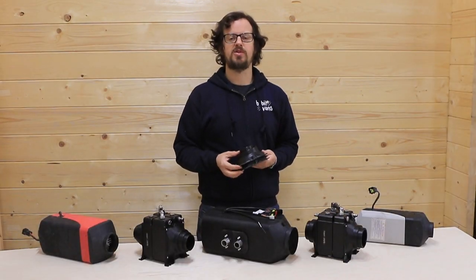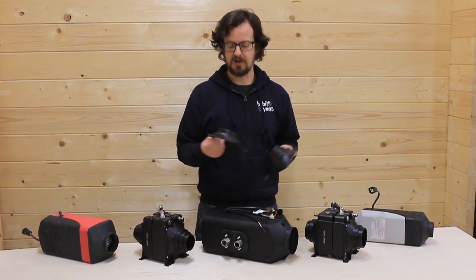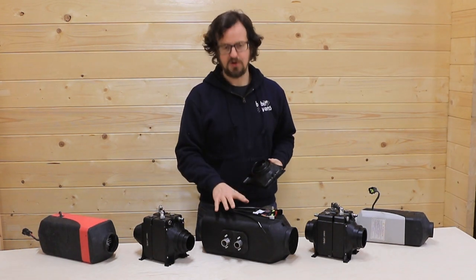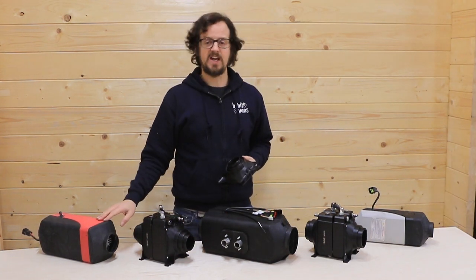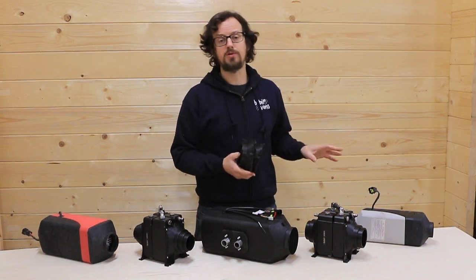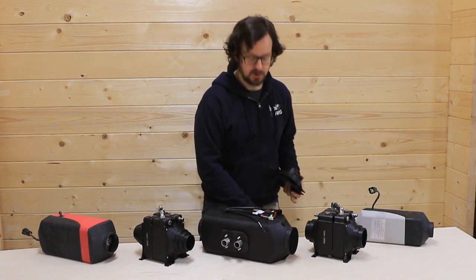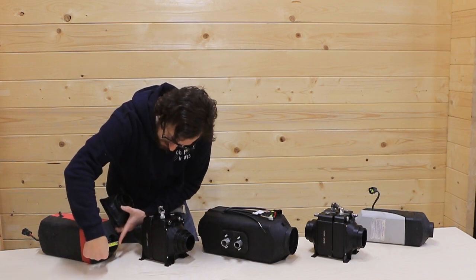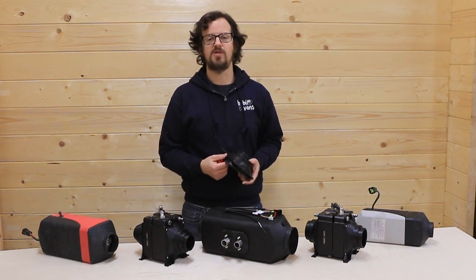If you've purchased one of the products that uses an air heater to heat the water, we'll need to know the ducting size so we can supply the correct size adapters to fit onto the heat exchanger. If you're using an Autoterm 4K, that's 90mm ducting. Chinese 5 and 8K heaters use 75mm ducting. Pretty much all 2kw heaters use 60mm ducting. If you're not sure, grab a tape measure, measure across the mouth of the heater, and the answer will be either 60, 75, or 90.